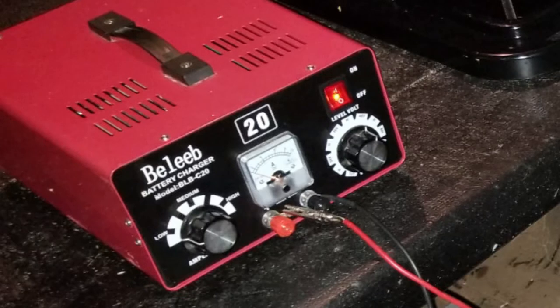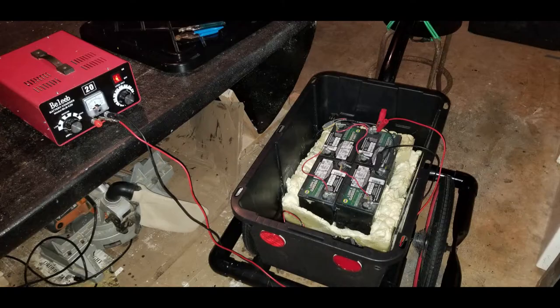Although a little large and clunky, this battery charger allows me to set the voltage and amperage for custom charging settings. The e-bike motor runs at 48 volts, so I use four of the car batteries to produce that 48 volt circuit and charge it to about 52 volts. The motor controller will cut the motor off at 39 volts as the battery discharges for safety purposes.